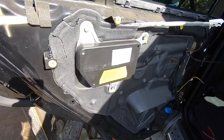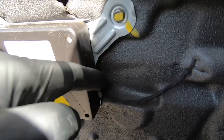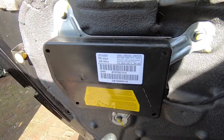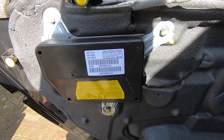Alright, so now we're ready to remove the airbag. To start off with, we'll remove the electrical connector here — there's just a top flat piece that pulls out and then we pull it straight off. Then we've got three bolts to remove — they take a 10mm socket — and then we'll just remove the airbag from the car and place it somewhere gently out of the way.